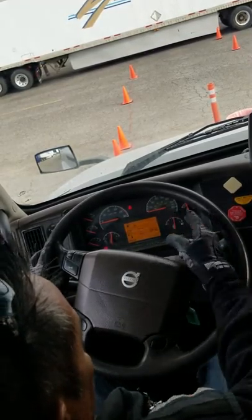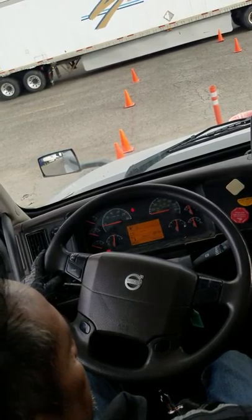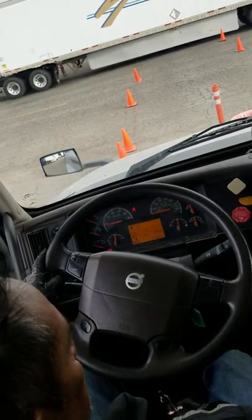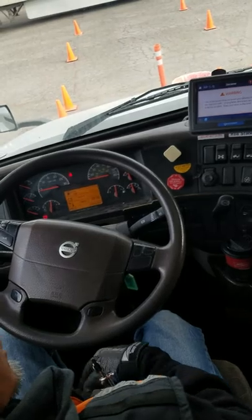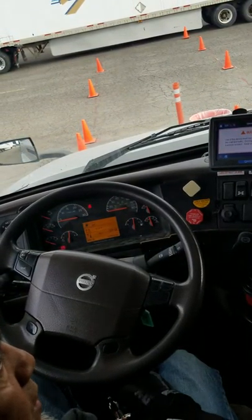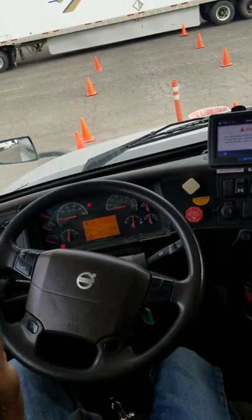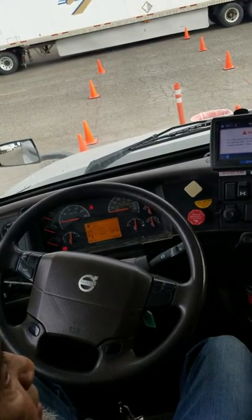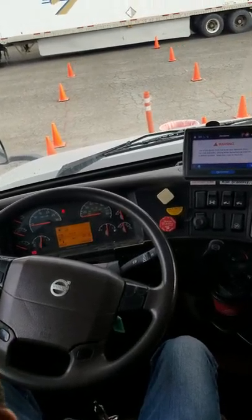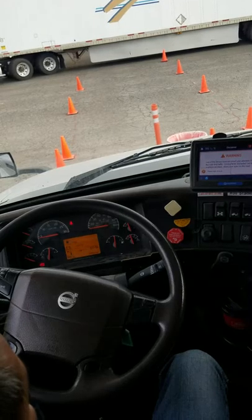Second reading. All right, Mr. Examiner, I am still at 90 PSI. I did not lose no more than 4 PSI within that 60 second count. So therefore, it's a good test. Would you care to check the gauge? Or can I just release my foot off the brake? Always ask for that permission, okay? He's going to say, go ahead, release your foot off your brake. Everybody understand that? So now the next test I would like to perform is going to be my pop-out test.